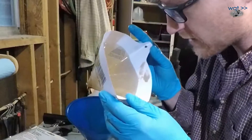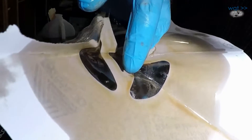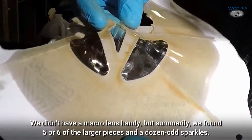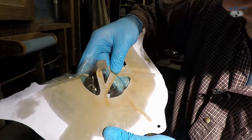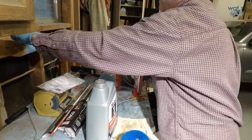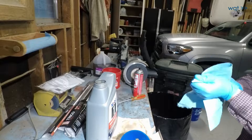Checking the filter — yes, those are aluminum filings from cutting the aluminum oil pan. There's a little piece here, another piece there — definitely cutting waste. That is exactly why we flush the oil out like that. It's a bit of a waste of oil, but no different than using cleaning fluid to flush out a component contaminated with metal. It's disconcerting to see that many pieces — I was hoping for one or two random thread fragments, but there are a lot of small metal flakes. Hopefully we got them all.